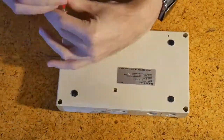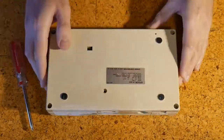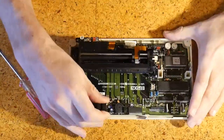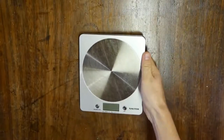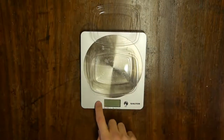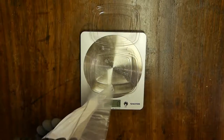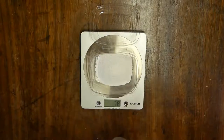The first stage is, of course, to dismantle the device, as I don't want to clean any of the electrical components — they probably wouldn't like it. The printer comes apart relatively easily into a pile of plastic pieces. The next stage is to weigh out the sodium bicarbonate. I did try to calculate how much I needed, but the maths didn't produce a sensible answer, so I just ended up with some — about 80 grams.